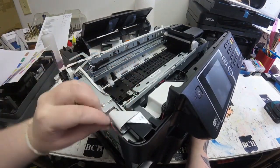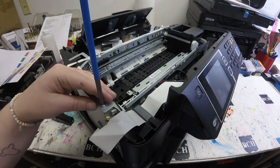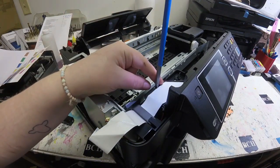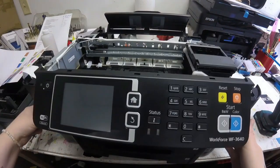This is where the LCD panel is connected, so I can take that wire off and undo that FFC cable, then unscrew the ground wire that goes down into the main board. There will be two screws holding that LCD panel — one on the left side and one on the right side.